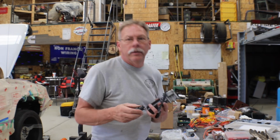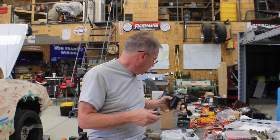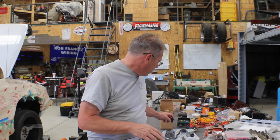But once you get your motor, now once I cut this off, I was committed, I owned this motor, so I needed to make sure it worked first, but I was having trouble getting all my stuff on these little pins. I finally just decided I was committed, cut it off, was able to strip the wires back, and then I could put alligator clips on all the wires and test everything to make sure I had it figured out.